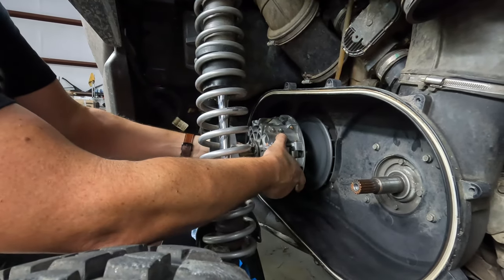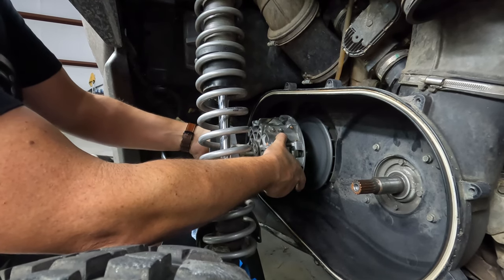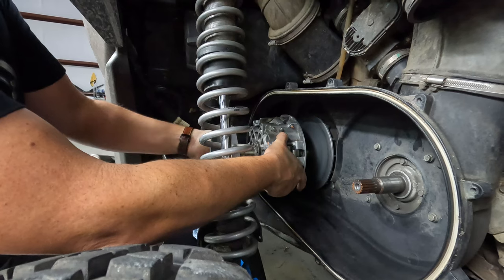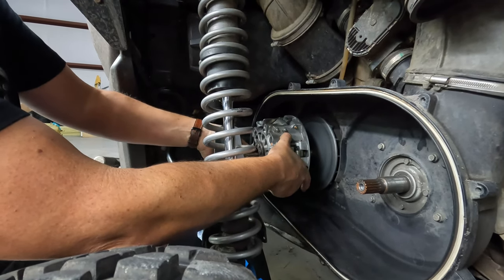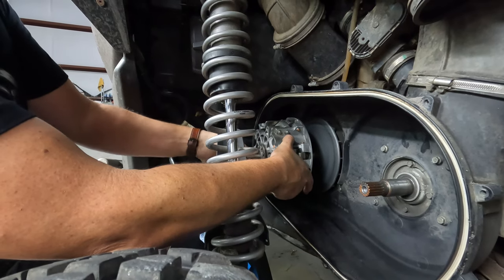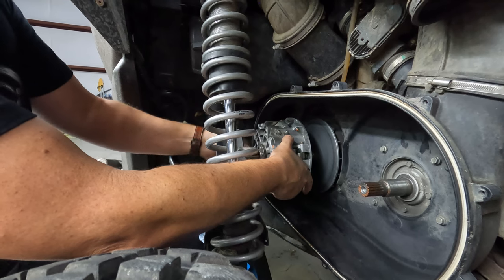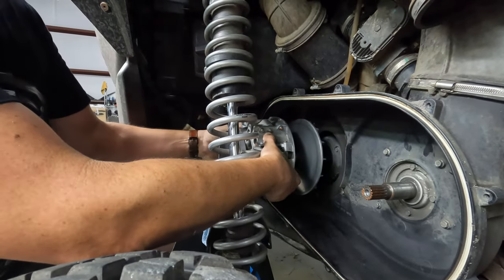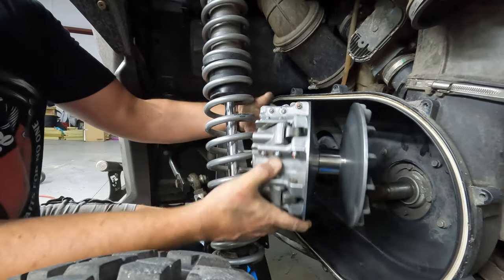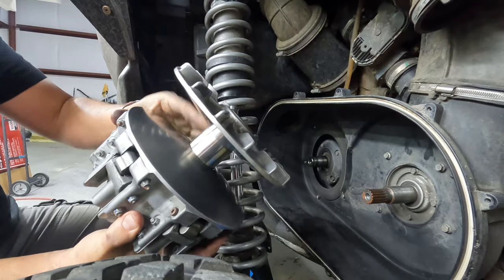All right. Yes, you do have to take this tool out. You don't have the clearance in here. Maybe you do on an RS. I haven't tried that yet. But on the DSs, you don't. So that went very smoothly. We got the primary clutch off, the crankshaft. Tools out. And the primary clutch is off. So that's what we'll actually be replacing, is that primary clutch bearing.